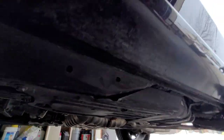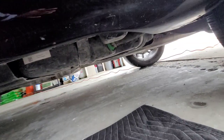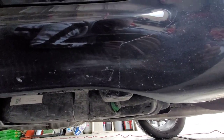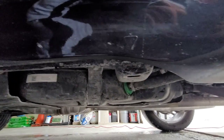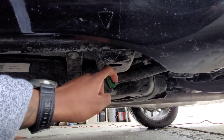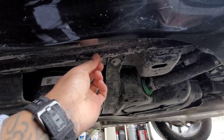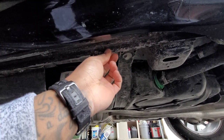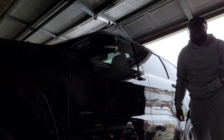In the back, same as the front, there's a little triangle arrow for the floor jack — I'm going to put it on this part of the frame and it will hold. There's also a pinch weld section that you can put a jack stand to hold and support. It's the same thing on the other side. We're going to get the jack under there and get this truck lifted up on both sides so we can get that tire off.